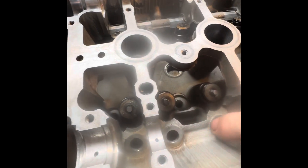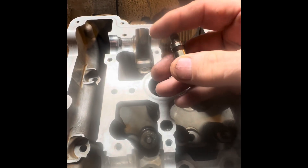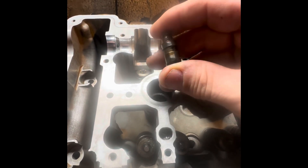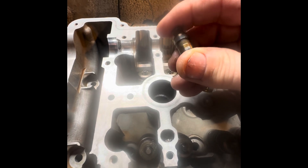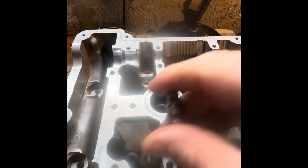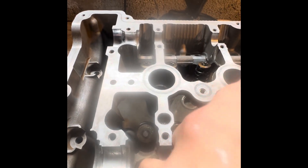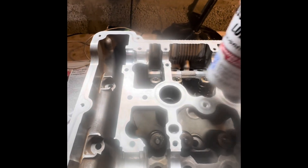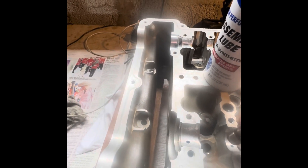So now I've blown everything up and checked it out with a high pressure airline, blowing everything out. These are for your hydraulic tappets. You want to just check those because when you took them out and they still had oil in them, you needed to squeeze them - they should have been really hard to squeeze down and then spring back. If they didn't spring back then they're faulty. You need to do that with a pair of channel lock pliers. We're going to put a little bit of engine lube on there, wrap it around and then put them in, putting them back the way they came - same one goes in the same hole.